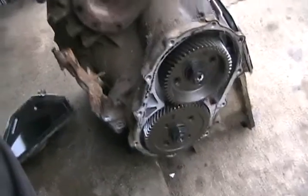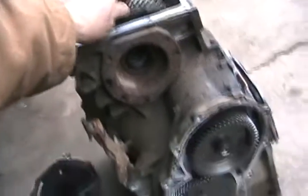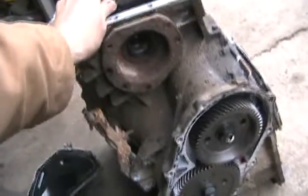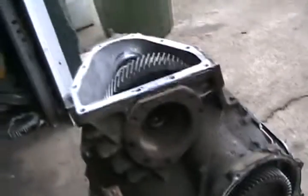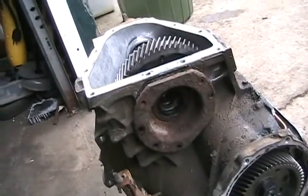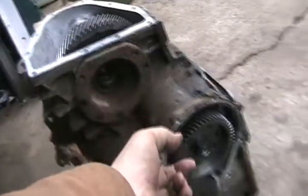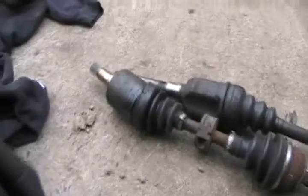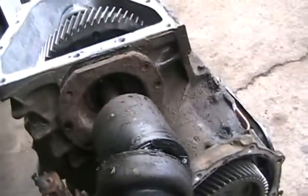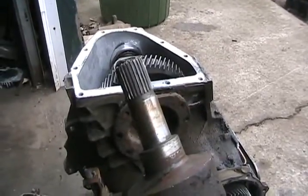These gears drive the final drive, which is here. If I rotate this, that's what happens when the vehicle's not in park. This isn't a rear-wheel drive differential, but if it were, there would just be two long smooth shafts going through your differential housing. On a front-wheel drive, we have two axles that slide in there, and the splines on the end grip the inside of the spider gears.